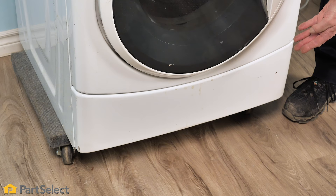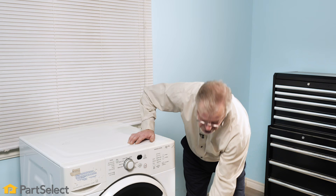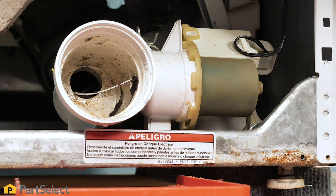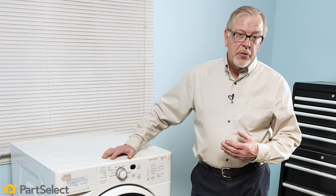If you're getting a loud sound from your washer that only occurs during the drain portion of a cycle, we might suspect that something is caught in that drain pump, or you may have a defective drain pump. To help identify that, we'll need to inspect the outer housing on your drain pump. On models that have a lint trap or filter attached to the pump body, you'll typically have either an access panel at the bottom of the washer or a small trap door at the front that will allow you to remove that trap or filter and inspect for any items caught on the filter or in the pump itself.